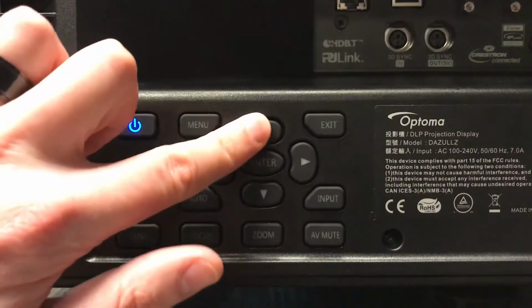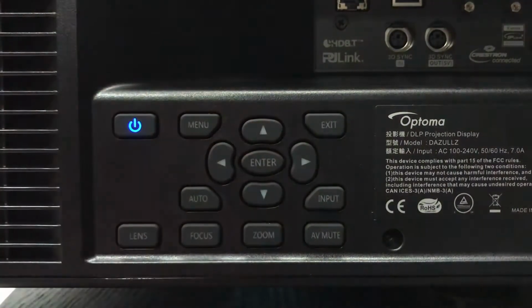Zoom controls the back focus length, which will make the area of section 5, or the center box, clear and sharp. Focus controls the corners, or sections 1, 3, 7, and 9. Now if necessary, and it may well not be, you can use the included tools in the following steps to further adjust bore sight gears A, B, and C.